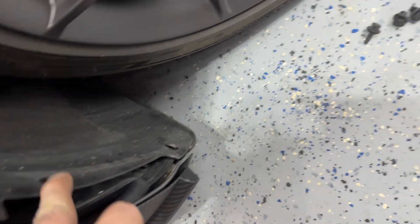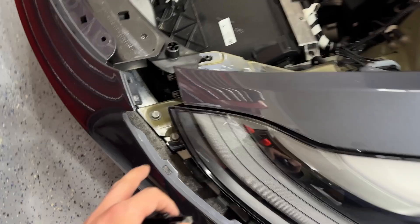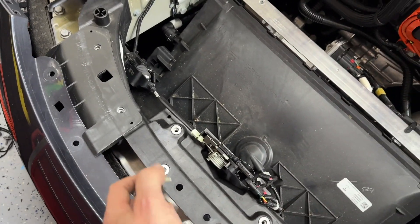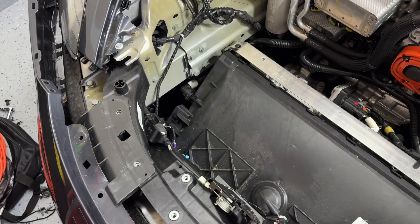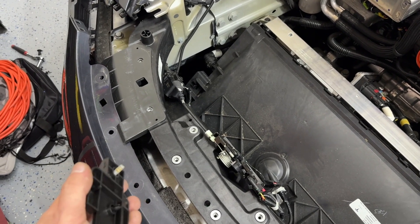So you just take off all the bolts up front, and then over here on the side you take off the three little plastic pins. Then on the inside, right up here where the bumper is attached, you look up and you've got three — one, two, and then a third one right under there. You just take out the last one right up here where that hole is. Same thing with the other side. Then you take all the pins off on the bottom where my splitter was, and then you just pull out. These ones are a little difficult — you can get them started and then get your little pick in there, push down on those tabs, push it out. I just have it pushed out this far so I can get my hand to the front, because I tried going underneath and it was not working. All the pictures you see online about this thing being put up front, even in the service manual, is wrong — there's no mounting point where it says. The old ones look like that, the newer ones like mine — a 2023 — do not look like that. But that is the best spot, right in there.